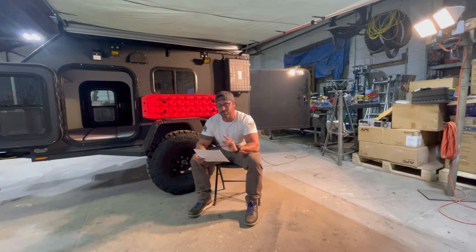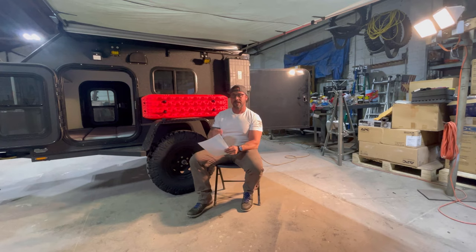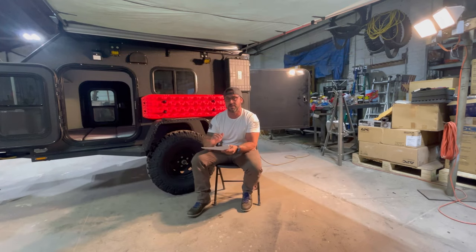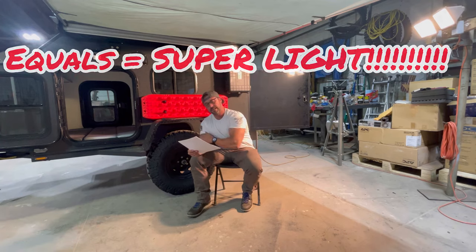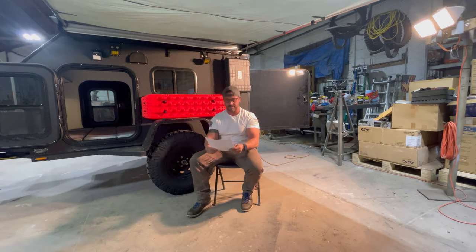The neat thing about this one right here is the marine fiberglass panel underneath. It goes from the front to back. It's fiberglass on top of those metal braces at the bottom, with the urethane floor on top of that. This is crazy. It's 1,191 pounds, dry weight, period. Tongue weight, 164. It's 5 foot wide. These fenders add 14 inches, so you can do the math there.